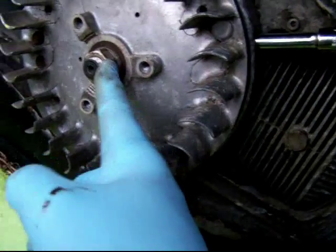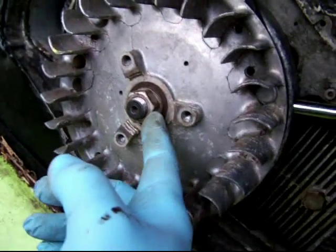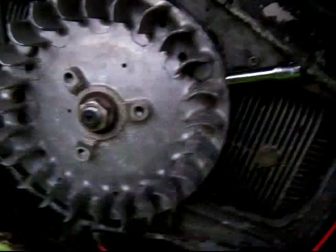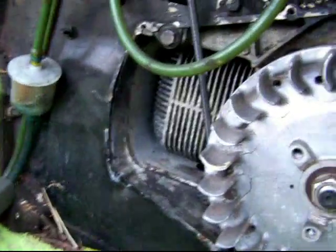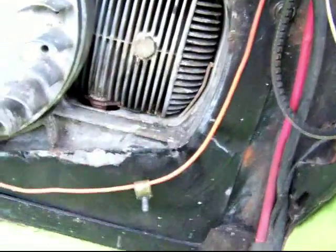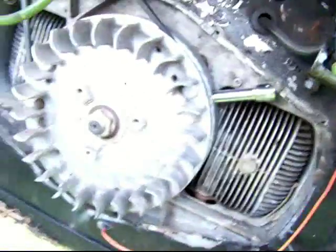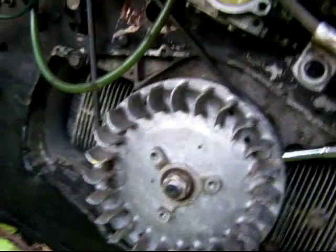I use this same system for here, though I have an air tool that just pops this off in no time, and a portable bottle of air, which is also very beneficial. I don't use that for reassembly, which actually reminds me, I never over-tighten anything on the Trackster. Just snug is good enough. Don't need to strip threads. Nothing ever vibrates loose. And I use anti-seize, a copper-based anti-seize, when I reassemble things so that things always come off easily during the next service interval.